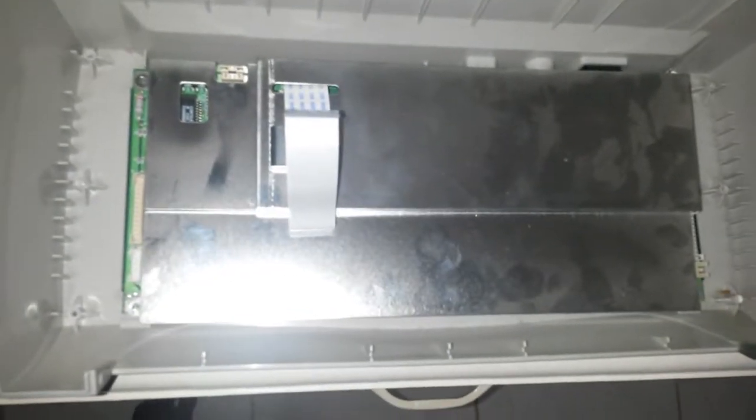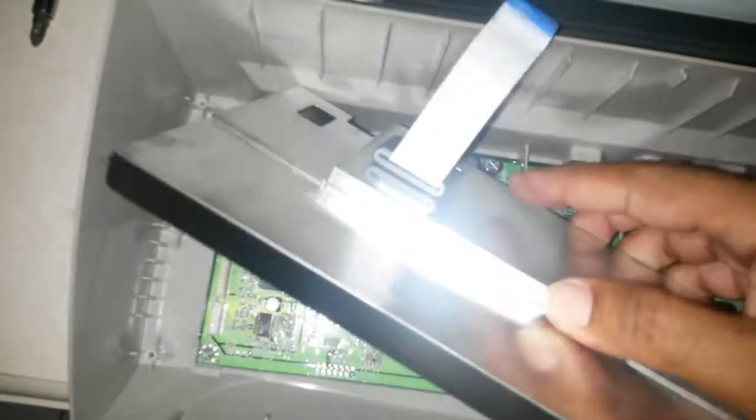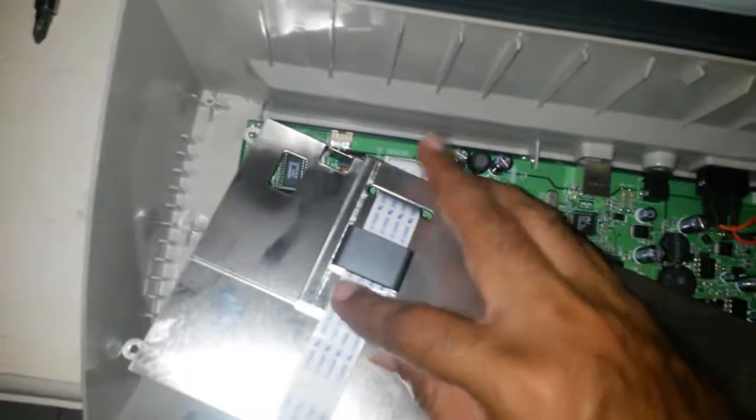Well, it turns out that the actual processing seems to be at the base, and there's a double-sided scanner. I forgot that, so that explains why all those wires went up on the top. First thought was that was actually where the processor was, but it turns out no, it isn't. So a couple jacks that I unplug, a ground wire, shielding, a couple jacks on this side, and then there's a run through again a decoupling ferrite. So let's have a look on the bottom here and see where this is.